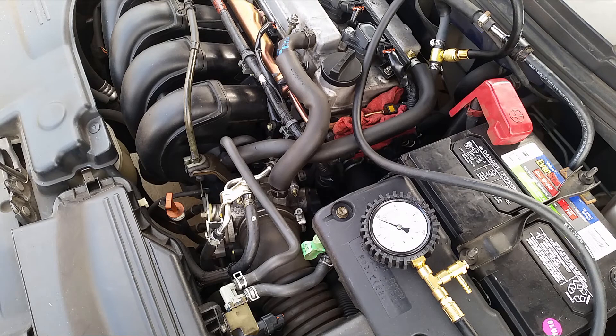This was like 20 minutes ago. Information online is saying it's normal for the pressure to slowly drop. If it drops too quickly then there might be a leak somewhere — either in the fuel pump area, whether it's the check valve, or in the injector rail area. But it seems like the pressure is holding and slowly falling, so it seems like there's no leak in my vehicle.